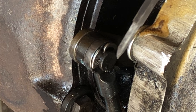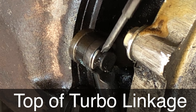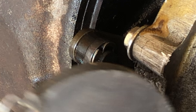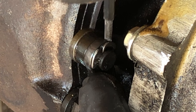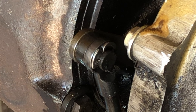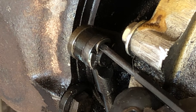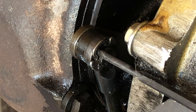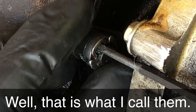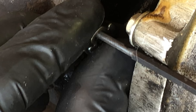So I can show you that clip. The one you're going to work with first is right here. The thing's going to get lost if you just go prying at it with a screwdriver, so put a magnet on your screwdriver. If you've got a smaller magnet that's better. Now these little clips like to fly — I call them Red Bull clips because these suckers got wings when they pop off. So I'm going to put my finger on top of it and pry it off like so.